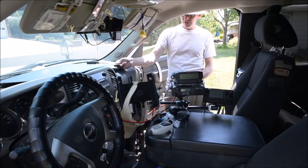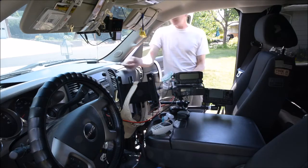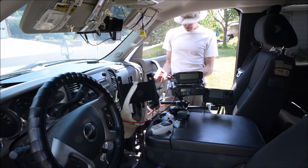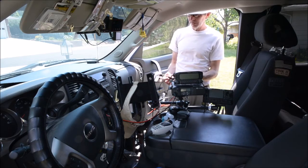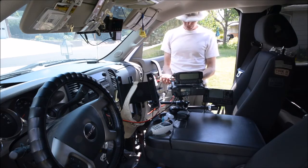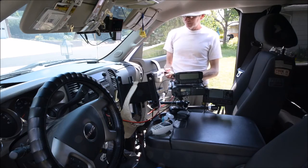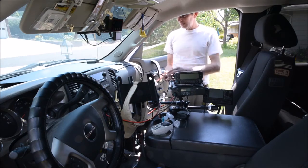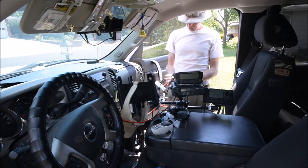So I'll keep this handy in the truck and use it to make sure the truck battery stays good. I don't think you'd want to have this thing plugged in when the truck is running. Some other ham friends that are big on solar taught me how to do this stuff, which is very easy. They said not to have it being charged twice. So if your truck is parked and stationary, off, you want to keep the battery topped off, fine. When you jump in, just disconnect it from the battery and the charger controller here probably. But it's working awesome.